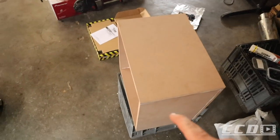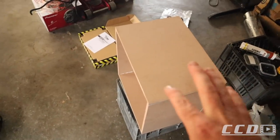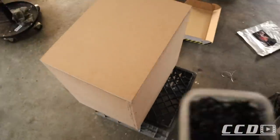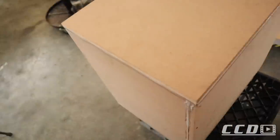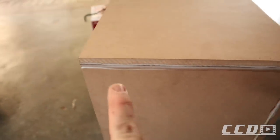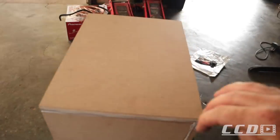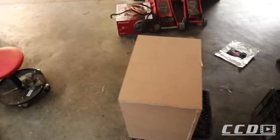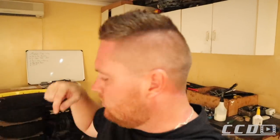While the glue is drying, I just finished putting this together, so I need to leave it for an hour. But while this is drying, I'm going to put these screws in on all the joints. So I'll put in a couple there from the top, put in a couple there, there, and everywhere. But I'm first going to use a drill to drill a small pilot hole, so that once we put the screw in, it does not misalign itself or anything funny.